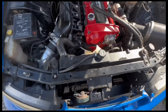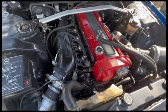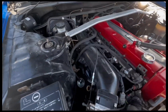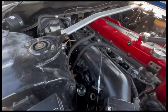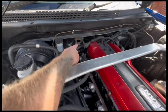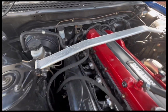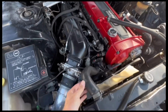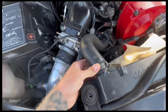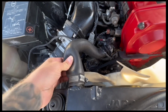I have purchased all new coolant hoses, because you know we had the coolant issues, a coolant hose burst, and we went to JDM Coombe on the way back, where we replaced it with a piece of hose. Basically we chopped a bit of that off and used that, recycled it, and that should be sound because those are still good. But all these have been on the car since 1996, and look at them, they're literally about to blow up.